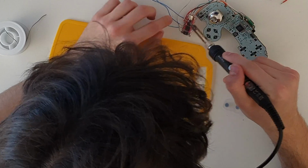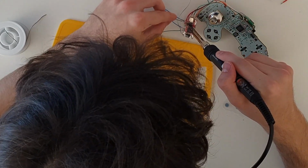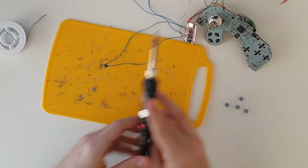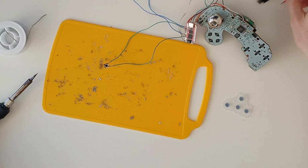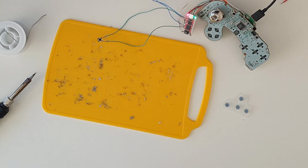At the time I was still writing the firmware, and I didn't find a way to make the board read the controller inputs as soon as it was plugged in. As you will see in the video, I found a way to do it, but keep in mind that, if you are trying to do this, wiring the right Z button separately is completely pointless. Just wire the additional Z button if you want to try it.